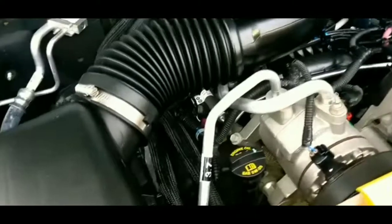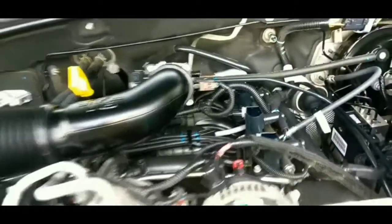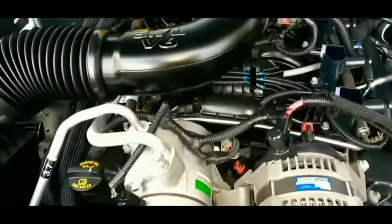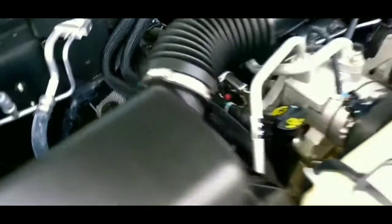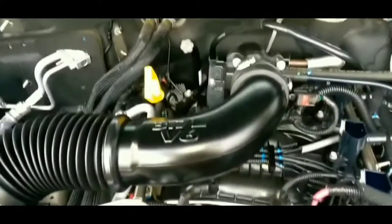It cranked each and every time I tried to turn the car on — it would crank but it wouldn't start. Originally I thought it might have been the battery. I remembered I had changed the battery about six months ago, got it from Walmart — a value brand. I was hoping it was the battery because that was one of the cheaper fixes, but I was on the fence because the crank was very strong. Normally a weak or dead battery would give you a slow crank.